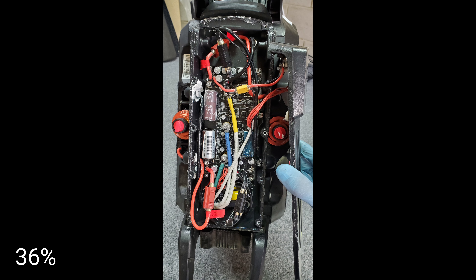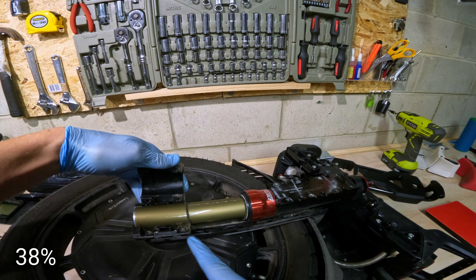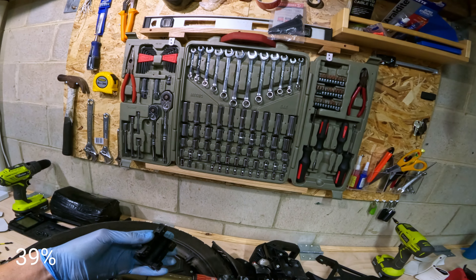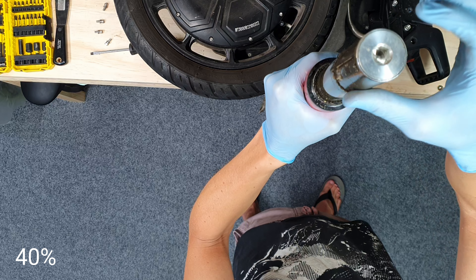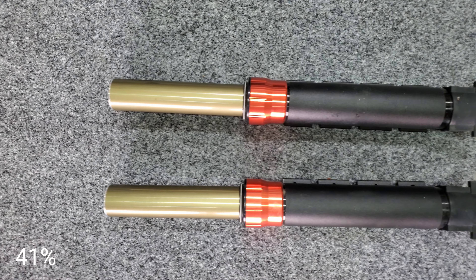The condition of all the wires looks good. The capacitors seem to be in good condition — no bulging. I did notice the left suspension had a little bit of oil seepage, which meant extra grime and dust built up around that area. It didn't seem significant, but it probably would be due for a service soon — I just ignored it for now.